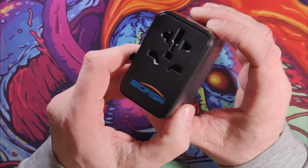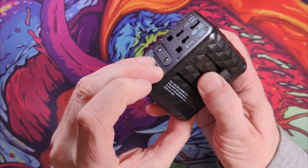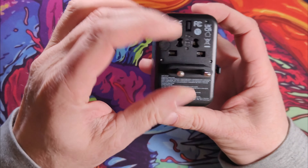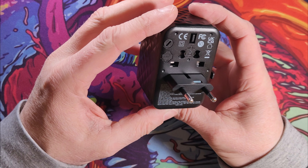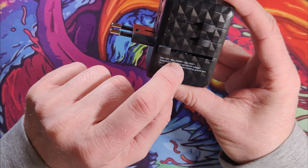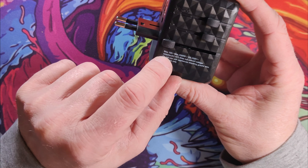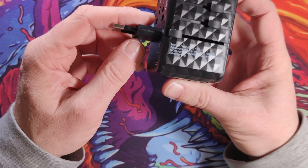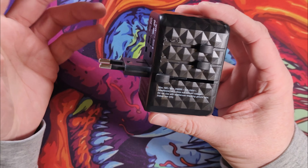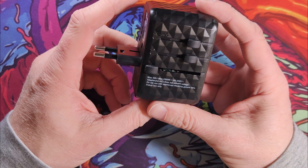So that's a 65-watt charging brick for about 40 quid — actually that's pretty good as it comes. But better than that, I can now use it in Europe because it has a European adapter. It should hopefully be 110-volt capable as well as 240 like the UK and the US. It says a maximum of 10 amps, which is a maximum of 2,500 watts — 2.5 kilowatts. Anywhere from 100 to 250 volts. It's AC-to-AC, which is the adapter point here — it doesn't convert voltage. So if you're going abroad and your product runs at 240 volts and you go to Europe and plug it into 110, it's either not going to work or if it's a hairdryer it'll run at half speed.